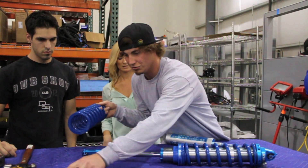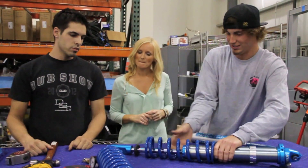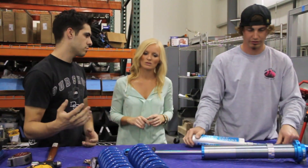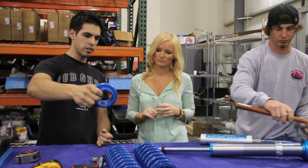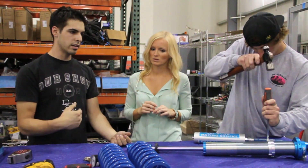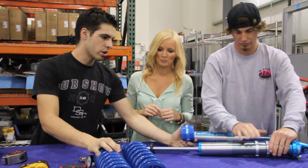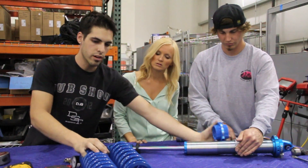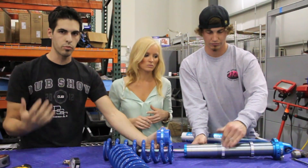As you can see, there's two springs on this shock. The reason there's two springs is actually for tunability. There is generally a stiff rate and a softer rate, but sometimes for tuning reasons they'll actually be the same rate. We have a crossover collar here which goes in between the springs. When the shock cycles, it'll be compressing both springs at the same time, acting together as a soft rate. But when this collar compresses to the point where it hits the crossover adjusters, the top spring can no longer compress, so it will only be compressing the lower spring and acting stiffer — it's just a primary spring rate, not a combined spring rate.